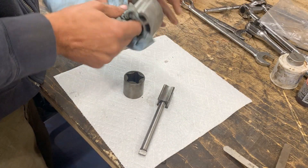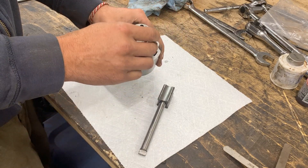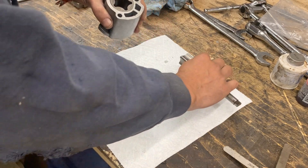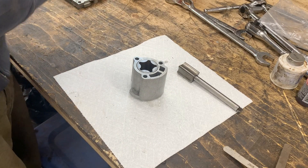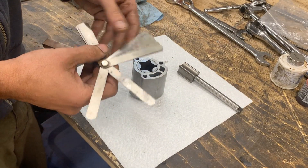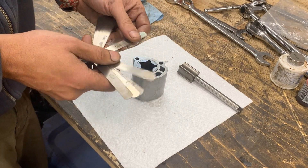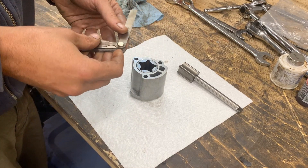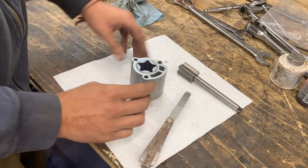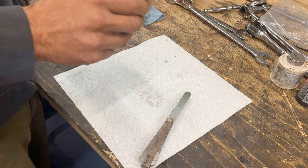While we're waiting, we're gonna check the oil pump. This oil pump actually had pretty good pressure so I'm not doubting it at all, but we're gonna check it just in case. We have the body, we have an outer rotor, and we have an inner rotor that goes inside. There are three measurements that are important. One is between the body and the outer rotor - that needs to be maximum 10 thou. I can see already there's no chance that's gonna fit, so I try with five - even five doesn't fit. So 4 thou - okay, 4 thou is good.